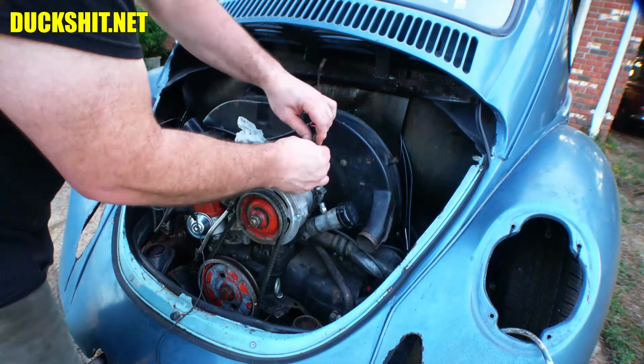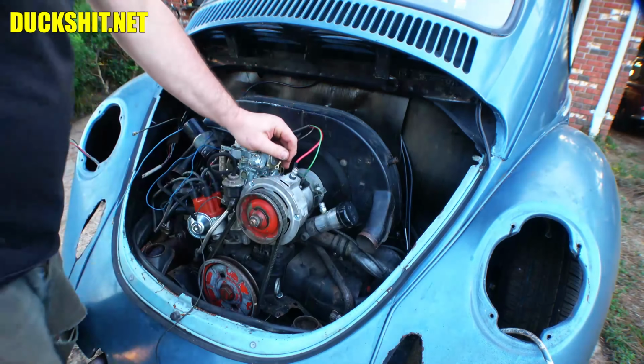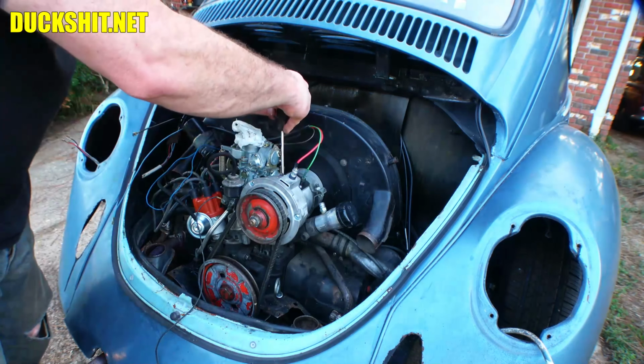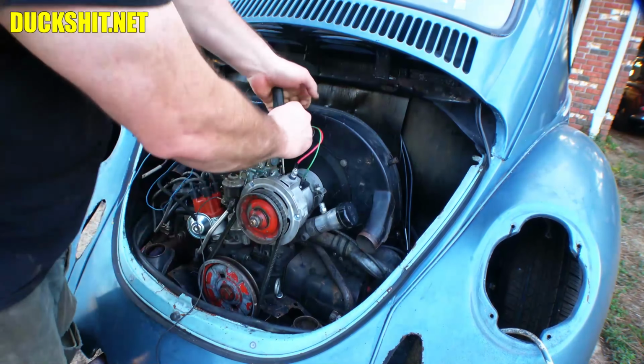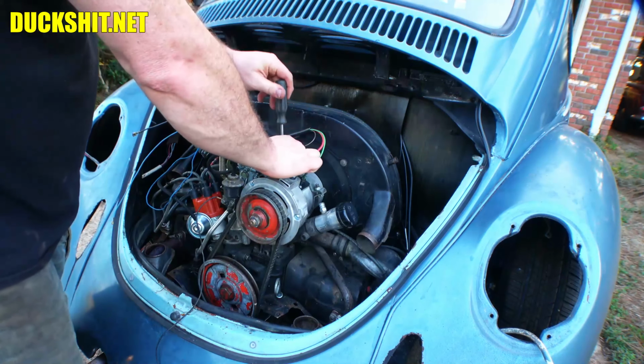All right, our green wire is the one that connects to the idiot light. And then the brown wire here is the one that connects to ground. And most alternators and/or generators have a screw on the side of the body of the unit, which is what this goes through.